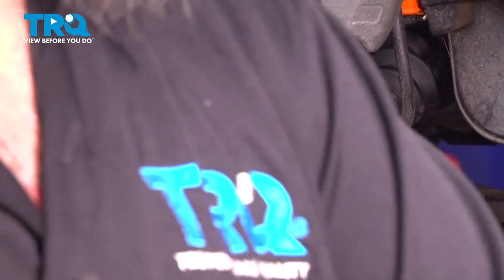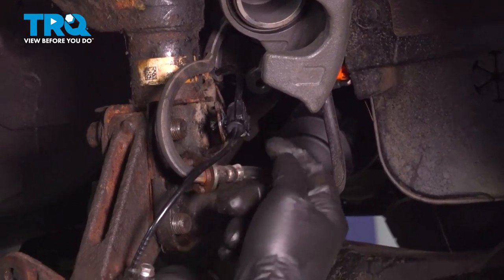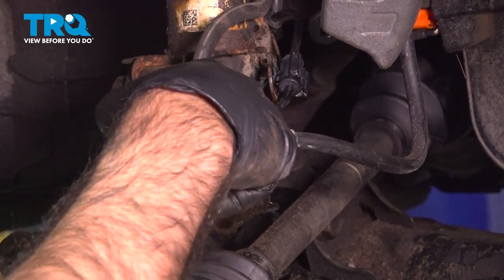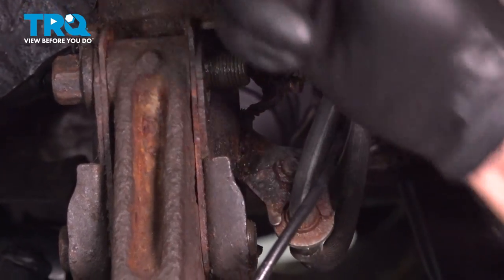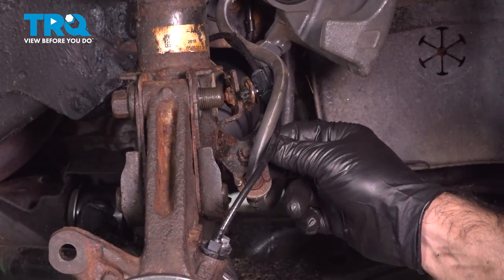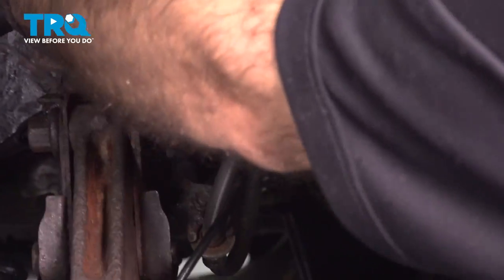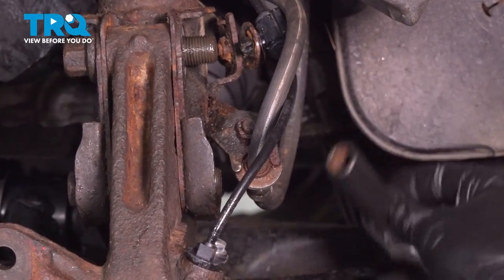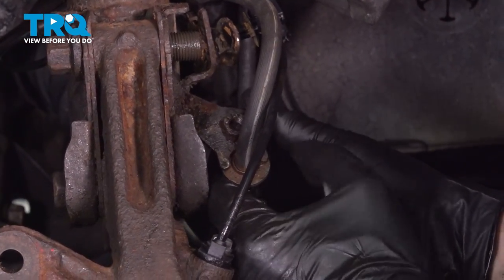I'm going to leave those two bolts in. What we're going to work on now is everything else attached to the strut assembly — our speed sensor harness and our brake harness attachment point. In our brake line here we have a bracket that is somewhat bent. This bolt did not want to move. Because we took our tie rod out, the entire strut assembly started to rotate. While putting force on this bolt, we actually put our tie rod back in so that the whole assembly would not rotate. We got that bolt to move just a little bit, and now we can continue to remove our 12mm bolt holding our brake hose to our strut.